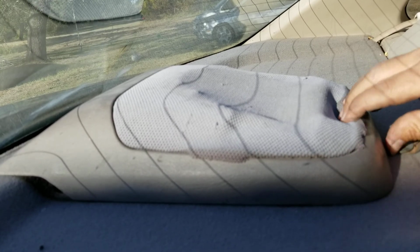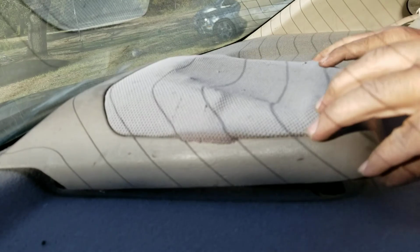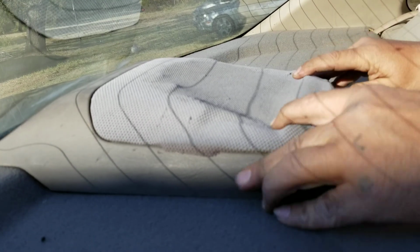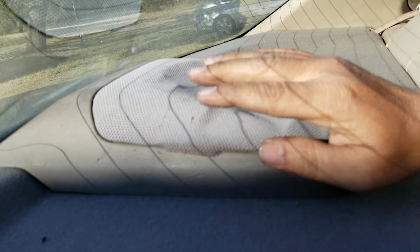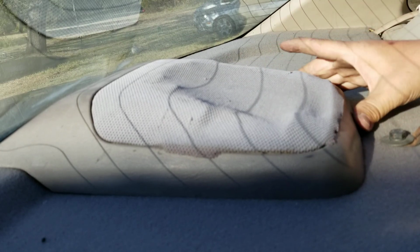Okay, there's little clips down there I was telling you about, those right there. You're gonna know if you catch them, you'll feel it. You can even look down from the front, but hold this down, push forward. Right there, the clip, see? Don't come up. That's how easy it is to change the third brake light. And it saves you from getting pulled over.